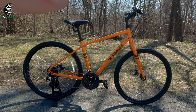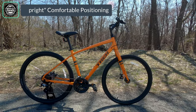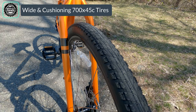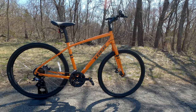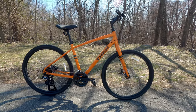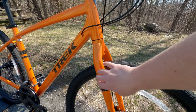The saddle itself is a little bit lower than the handlebars. You can see the handlebars have some adjustment to keep it nice and upright. And then you've got these large 700x45c tires. The 700x45c means you end up with road bike diameter wheels, but a nice thick tire to absorb bumps and vibrations. And that's going to be interesting when you compare this to some of the other comfort hybrids — you'll notice there's no suspension on the front end.